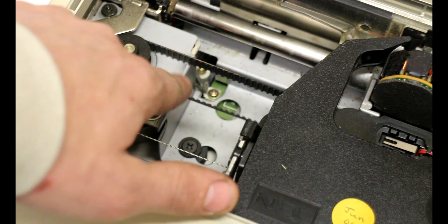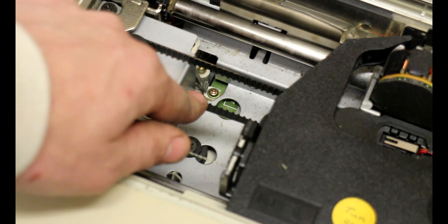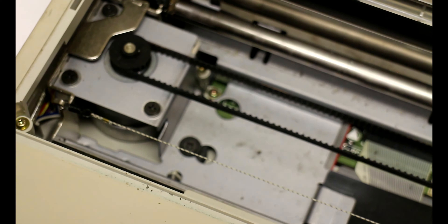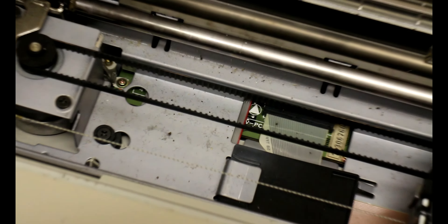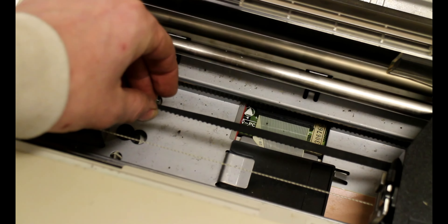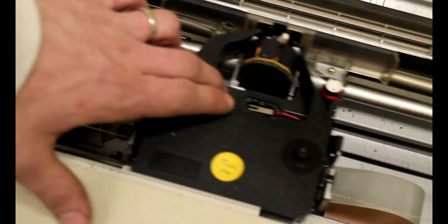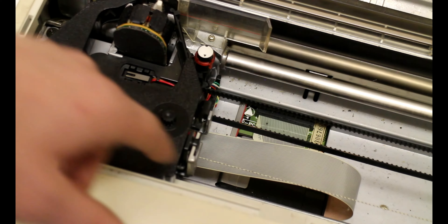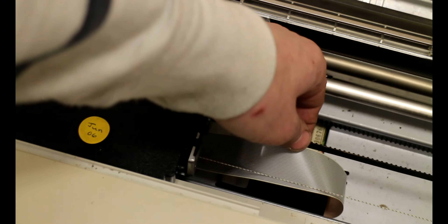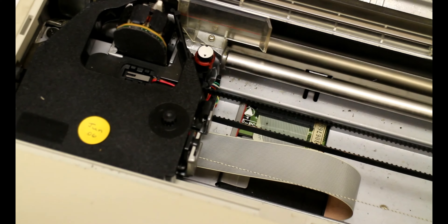This right here is the belt that drives the ink cart back and forth. A lot of the times this rubber will get very old, brittle, and corroded and crack — that could be one of the main reasons it's not working. Even if you're not able to test these electronically, still give them a good visual inspection. I can feel this, bend this — it's not cracking, it's not fraying, and I don't see any really bad marks in it. The guidance string is still intact for it to move back and forth, and the ribbon plug looks good. There are no bad cracks and it seems to be seated in there quite well.